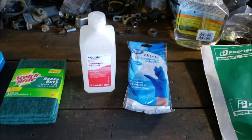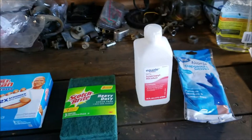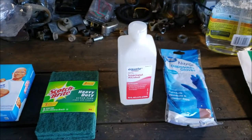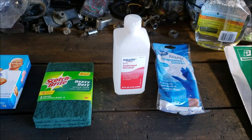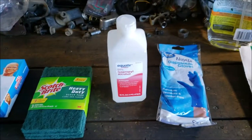Nowhere on these vehicles do they use seam sealer or pinch-weld primer, because I personally think it's just seam sealer with a glorified name. Nowhere do they use it and not coat it in some way or form. You just don't do that. They say, oh no, don't paint. Well, the factory's painted.